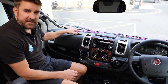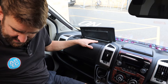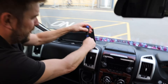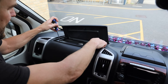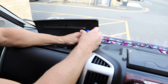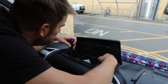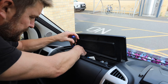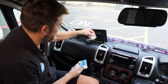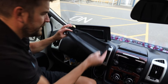The first thing we're going to start with is this top glove box - it literally just lifts up like so. You've got some screws in here and the only screwdriver you're going to need is the T20 Torx. You can buy it from us, no problem. Once you've got the screws out - there are two here, one in this corner and one in this corner - so we've got four screws total. Put those to one side. Always best to remove your personal items out of the little cubby hole, and then this one just pops up like so.